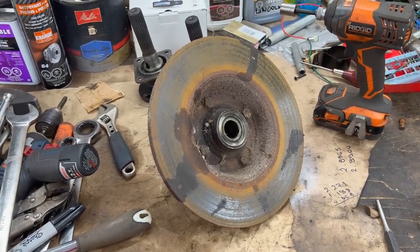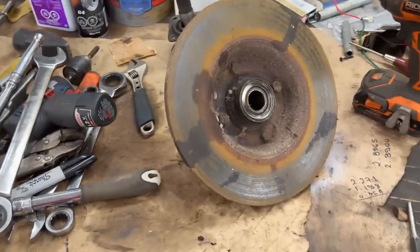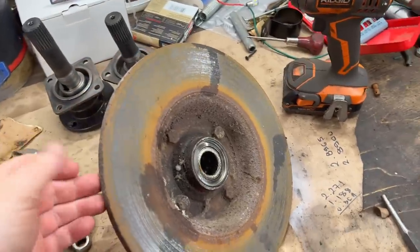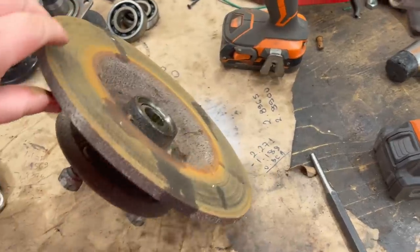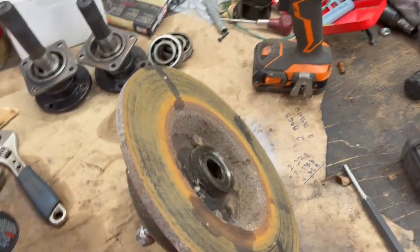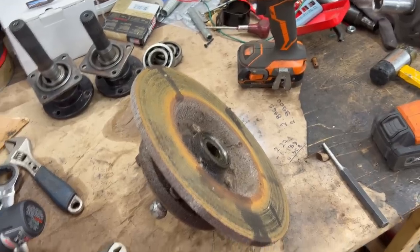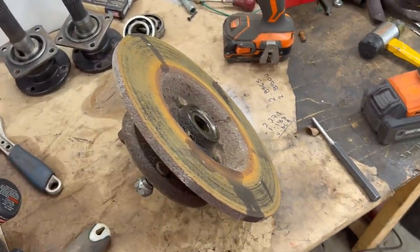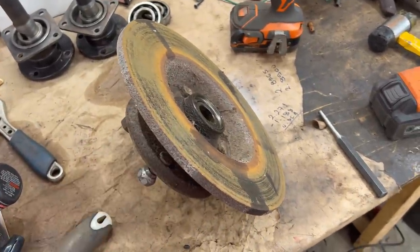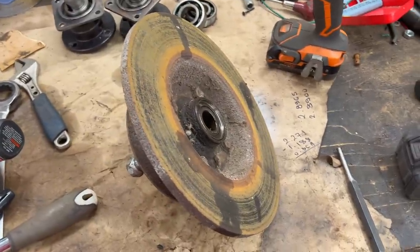All right, well, Alin's doing the welding. So I've finished the front suspension parts. I've finished doing the first coat on the exhaust system. So now we're going to focus back on the hub and rotor assembly here. We're going to separate these two. And we're going to pull the bearing out there and give the hub a clean, we'll get the bearing out, and we'll give that a good clean and re-grease as well. And we'll put the new rotor back on once we clean and paint the hub. So that's what I'm doing on the inside of the garage where it's nice and cool.